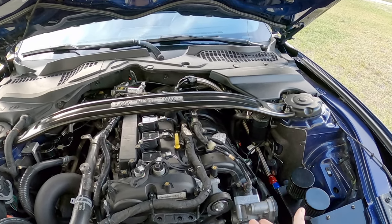These cars have programmed torque limits. It calculates off the load of the engine and multiple parameters. They know that at X RPM, X load, X boost, there's going to be an X amount of cylinder pressure, which equates to an X amount of torque production. This car knows how much power it wants to make and it is not going to make any more power than it's programmed to make. Overall, all the mods I've done here and there have picked up some power, but the car is never going to make any more power than it's programmed to make.